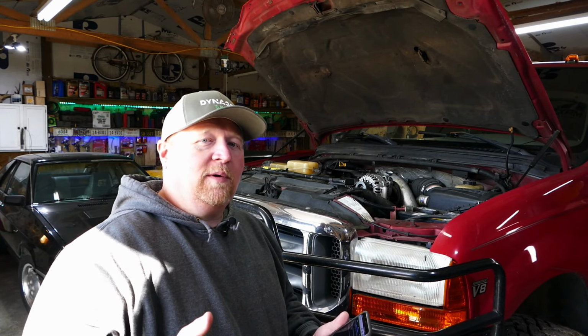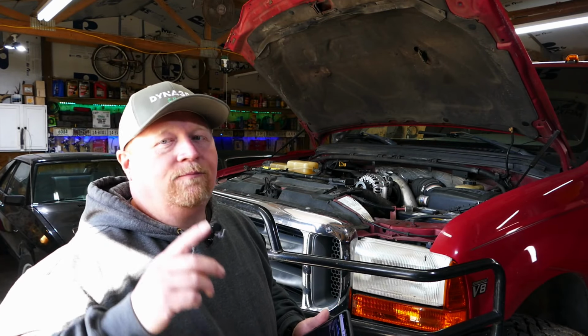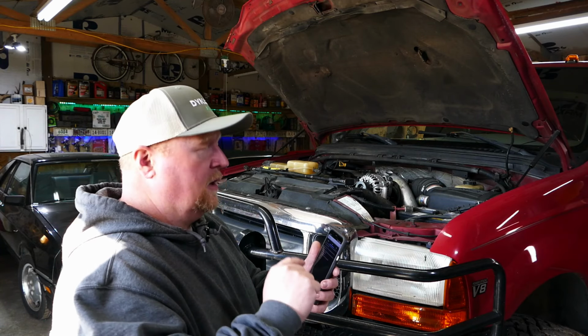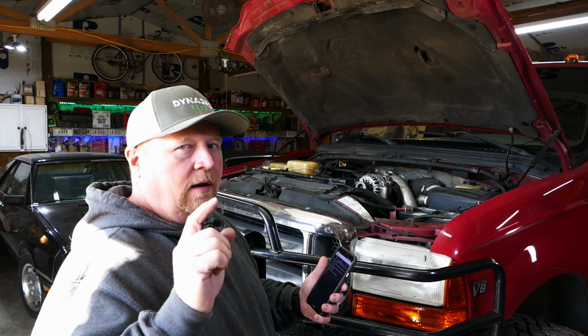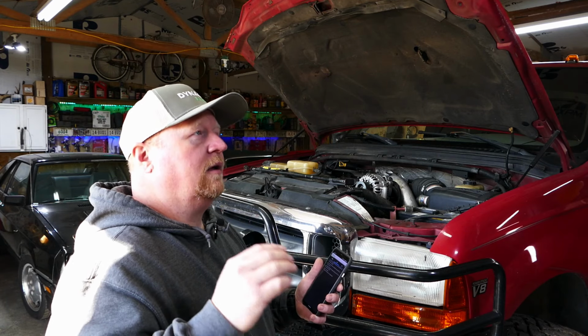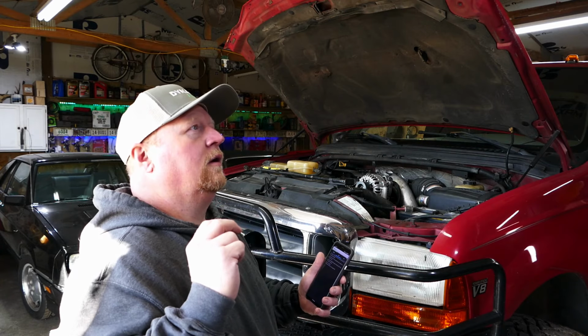We heard a loud buzz with 8 and then quiet and loud, loud, loud, loud, loud, loud, loud. Let's do it again just to make sure that our ears weren't playing tricks on us. Here it goes. All 8. This one will be quiet. Yep. Good, good, good, good, good, good. That tells me that injector 1 is definitely quiet. It's noticeably quieter than the rest.